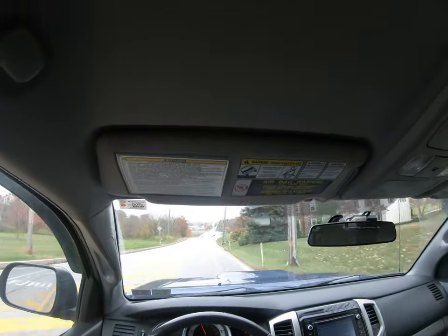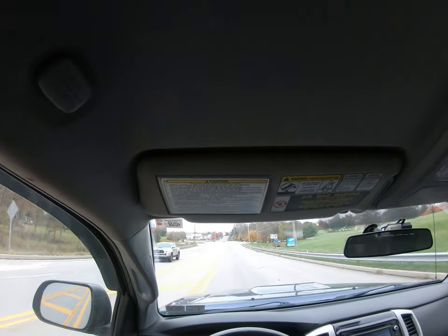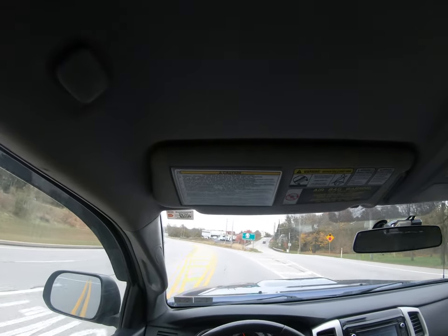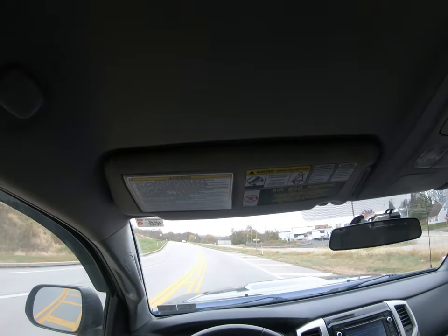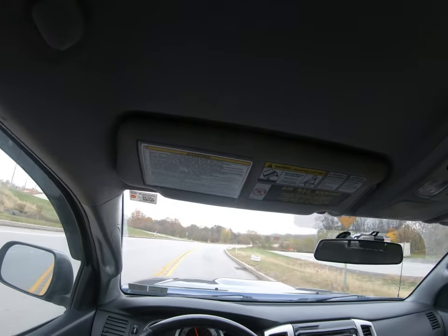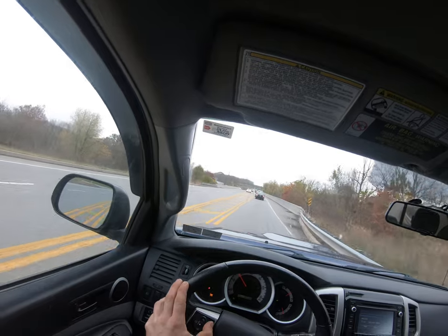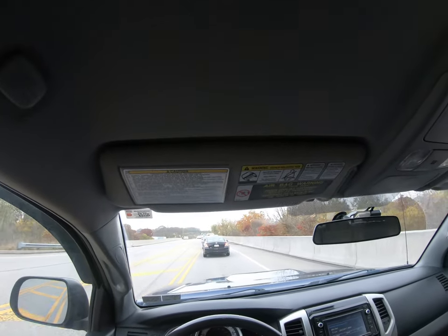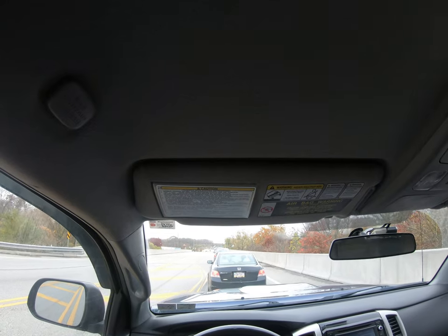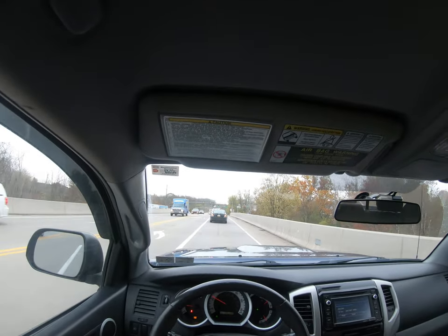When I got the truck, it would vibrate at 60 miles per hour — anywhere from 55 to 70. I took it back the first time and the dealership said my tires were probably out of balance. I ended up getting new tires — TRD Pro rims off of a 4Runner, bought brand new from the dealership — and a brand new set of General Grabber tires. Nothing crazy. I commute 50 miles one way to work, nothing big or knobby.